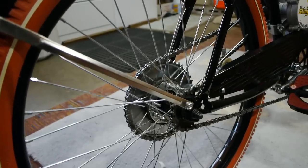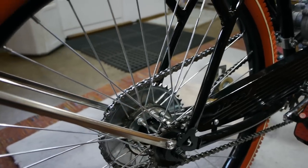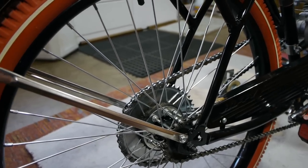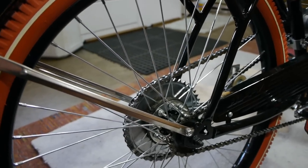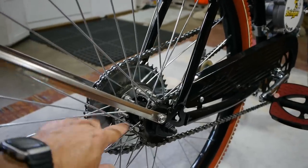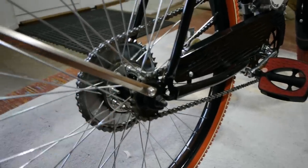When you're putting on the sprocket, you want to put these screws on. You want to put these bolts through pretty loosely before you make sure it's completely round, completely even. When you spin it, you shouldn't see any movement up or down. It should be completely round when it spins. So you put that on, start spinning it, and then you can adjust it and slowly tighten each one. And when you start tightening them, tighten this side, then tighten the other side, tighten up here, then go down. Don't start tightening them in circles.